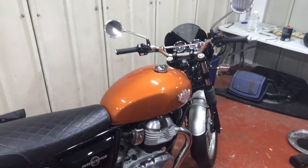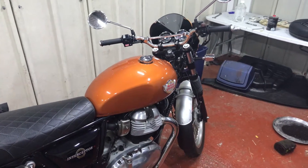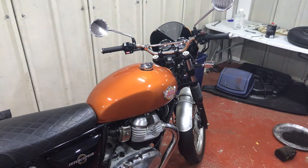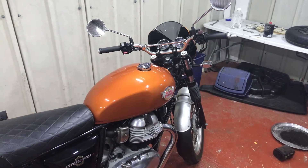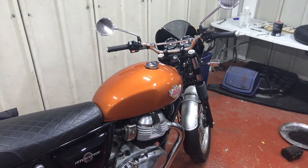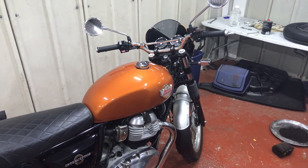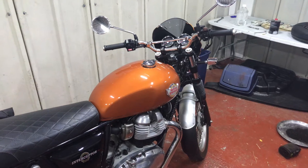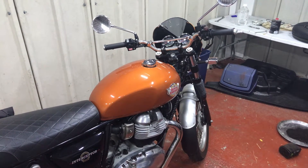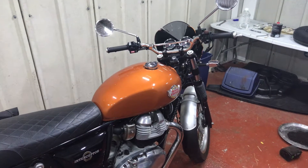The slightly tricky starting — I thought maybe that's just a peculiarity of the bike. Two or three presses of the starter button after a short run, and it did that I would say 75% of the time. Sometimes I'd press the button, nip up to the supermarket, come out ten minutes later, press the button — fire, stop, spluttering. It would always start with a bit of revving and throttle, but it was tricky.